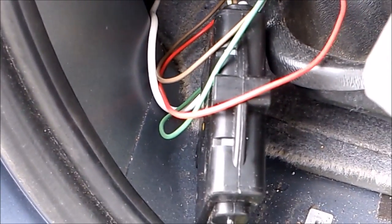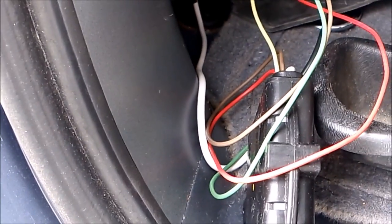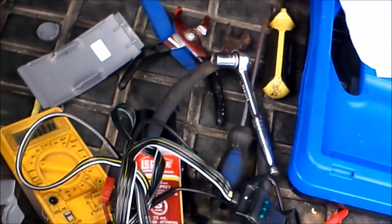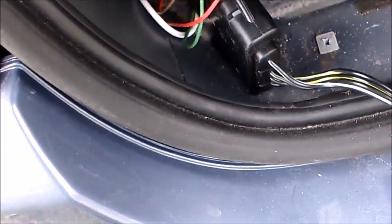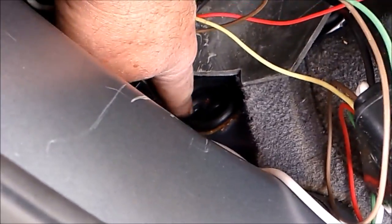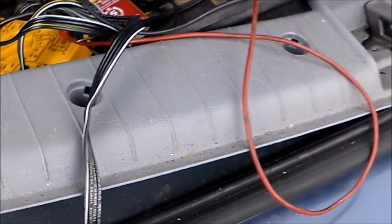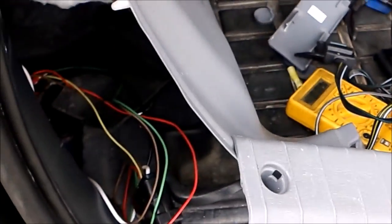This is all rubberized and insulated. I'm going to wrap the box in something — probably a piece of upholstery foam — tape it around just so it doesn't rattle around back there, then jam all the wiring back in. I don't tow a trailer too often, maybe once a month, so mine's not going to go down underneath the car. But if you do tow quite often, right where that wire is there's a rubber plug — a body drain plug. You can run the wiring straight down through that, cut a slit in it, run the trailer wiring connector down through and then run it under the body towards where the trailer hitch is.